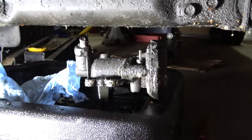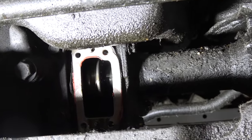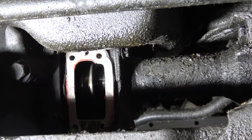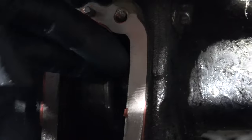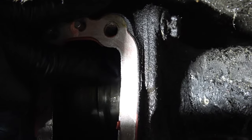So I got the actuator out — it's held by four 12mm bolts. A little bit of gear oil is still coming out, so I'll let that drain. You can see right here, this is where we do the modification. When you put it into four-wheel drive, the vacuum system moves this fork, which shifts this ring here. You can see this fork — when you're in two-wheel drive, that's where it sits, and it doesn't engage the axle.